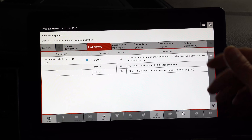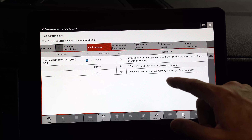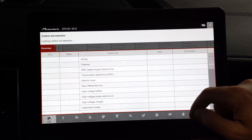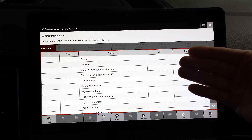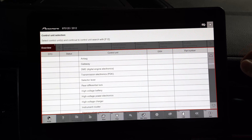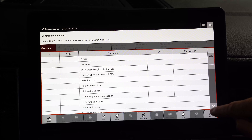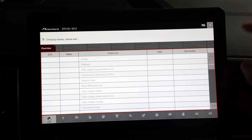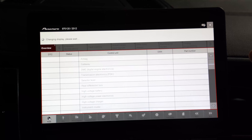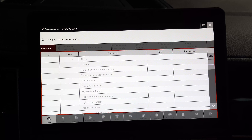I'm going to show you how to drill down, but today I want to go back to overview — I want to teach you how to check everything all at once instead of drilling down into each one individually. Once you're on your main control unit selection, instead of clicking on one, go over to F12 in the bottom right corner. It's going to go through and check every single one of our control modules, pulling all the DTCs — our fault codes — and bringing them all up as a list.